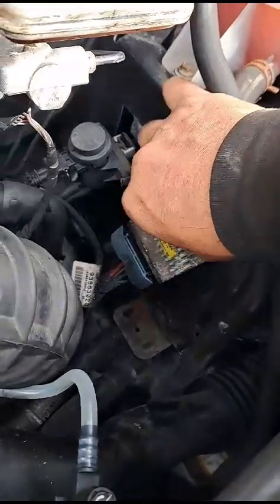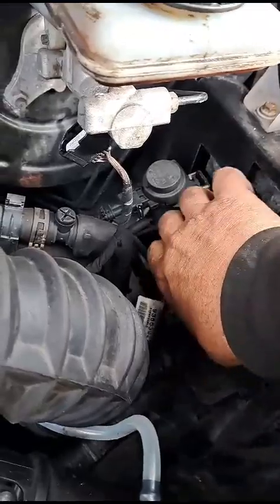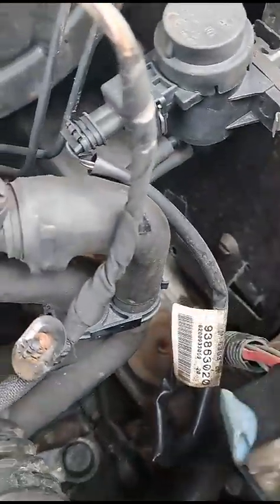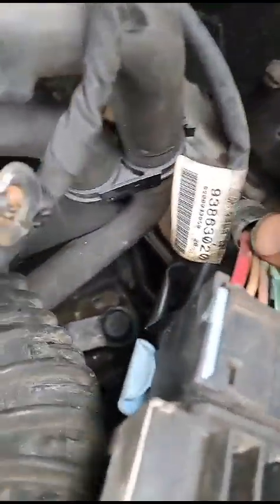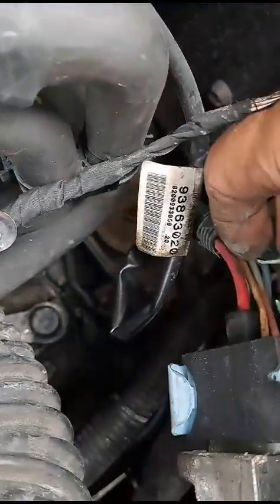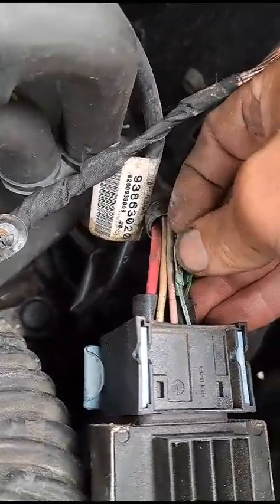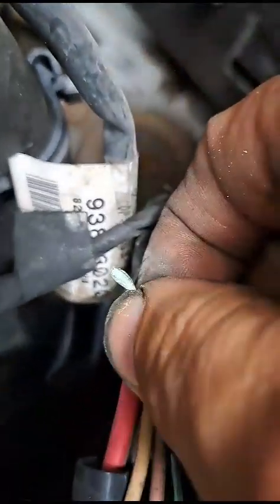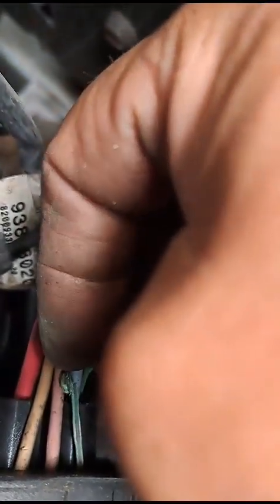There are two different types of these. If you get the glow plug circuit fault, look at the connector — you'll normally find the little white wire, or the green and black wire. Give it a pull and this one's already snapped, but normally they'll be connected and you'll see a little swell where the corrosion gets in and just corrodes and breaks the wire.